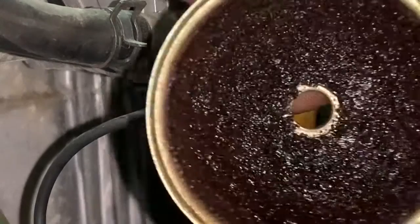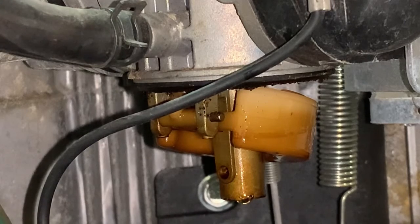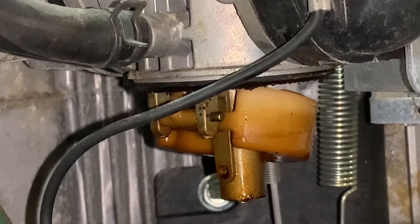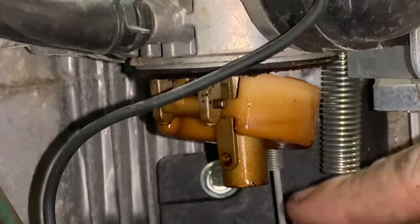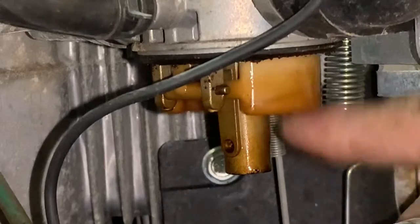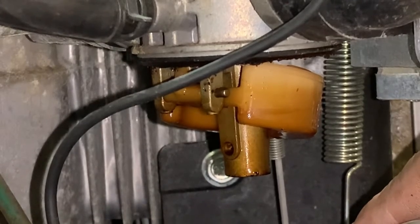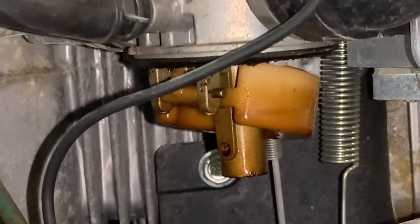Now guys, I'm not saying don't try to repair this, but in my experience when they're that bad, they've got orifices in these carburetors that are absolutely microscopic and they'll probably take a cleaning if you were to soak them in a caustic solution. But as a mechanic shop, you're way money ahead by replacing the carburetor rather than trying to repair it. If you're just a backwoods shade tree guy that has a lot of time on his hands, by all means try to clean this carburetor — I'm not telling you no — but it's just money ahead to replace it.